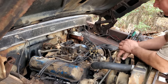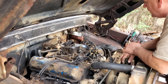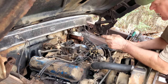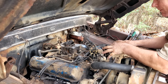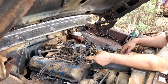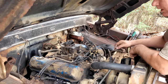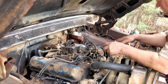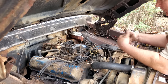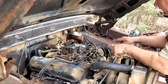I guess we got our answer. It's the carburetor on this one right here too. Tell you what, it's going to rain, like I said. I winterized this a while back, and by that I mean there was a plug over here pulled out of the block. They had a petcock over here, opened it, took the bottom radiator hose off, drained all the water out. So let me get that unwinterized, put some water in it, and we'll drive this thing to the garage. Oh yeah, I like that a lot.